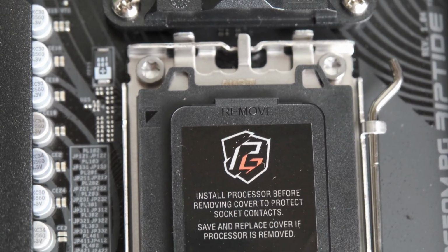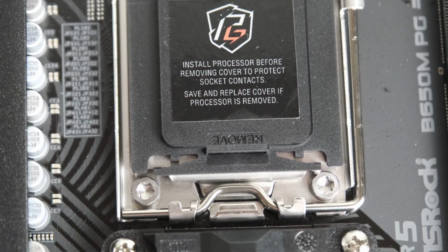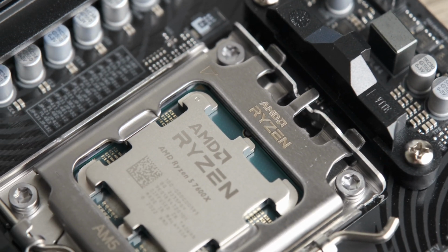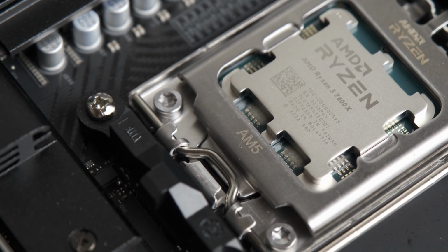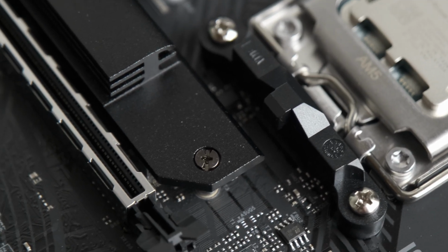Starting with the obvious, for this generation AMD has opted to go for an LGA socket, similar to Intel. The mounting holes for the cooler are slightly different for AM5, so double check compatibility with your CPU cooler. Any cooler using the plastic tabs on the default AMD brackets will be just fine, including all Phenom 2 and FX stock coolers as well as Corsair AIO.